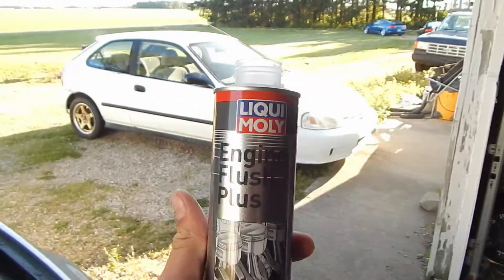She works! It does have the 5-speed transmission — longer gear ratios, a little stronger. It has a stage 5 competition grade clutch, 440 injectors, standalone ECU — basically everything you need. It's a Greddy turbo kit, the entire kit with intercooler and everything. I kind of want to get it dyno tuned professionally, E85 swap it, and make it into a monster. It even has a stock exhaust — I think I'm going to use an HKS exhaust and get rid of the catalytic converters because I want to shoot flames out the back and have some fun.